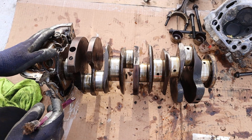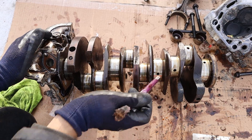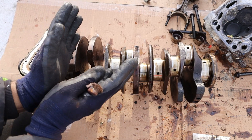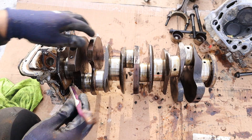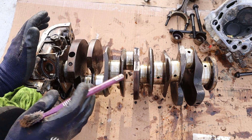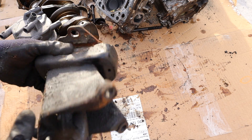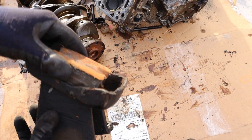Here's what the crankshaft looks like - I couldn't get that oil pump off but it would just sit right here directly powered by the crankshaft. You can see we have four main bearings, and in between you've got two pistons about 60 degrees apart running in a V-shape. Side to side you might be balanced but along the axis you only have three sets of pistons, which is going to cause the motor to rock. Overall it's going to be smoother than a four-cylinder, but people actually prefer the four-cylinder in these trucks because they're just easier to work on. Check out this engine mount - just a piece of rubber on a bracket, long before the days of active engine mounts.